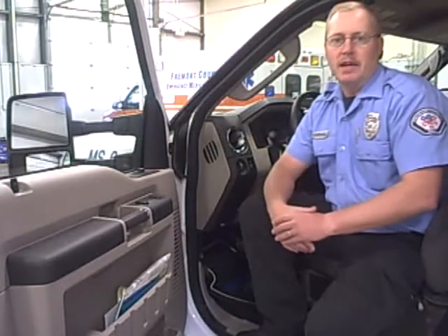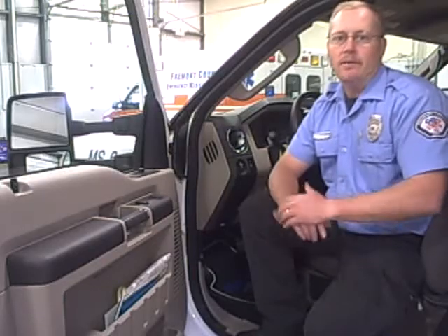You don't have to do anything beyond that. The other thing we need to be aware of as EMTs is that we don't leave these sitting on scenes for extended periods of time — an hour to hour and a half tops, and then we need to get them off. We do have some football standbys; if it's warm enough outside, obviously don't run it. Anything below 40 degrees, go ahead and run it. We want to try to avoid excessive idle times on these vehicles — get them back in the station. If the vehicle is going through the regen process while you're finishing up a run, simply park it outside, set the brake, let it finish its regen process, and then go back to normal operations.